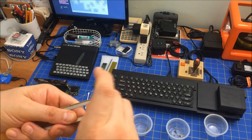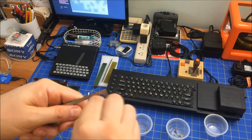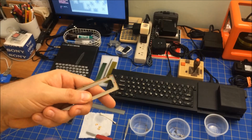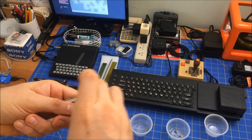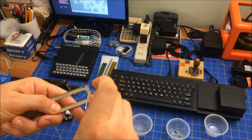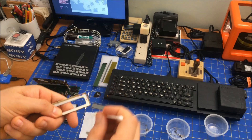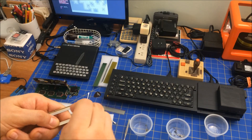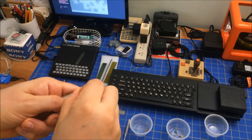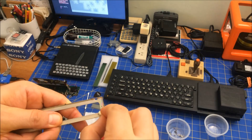Just going to rub it on here to try to get rid of the remnants of the glue - it's a painstaking process. This is a nice strong piece of metal, so it's going to be hard to bend, but you still want to be careful because if you bend it you can't mount the new LCD screen on there. I think that's almost free of all glue - there's still some, so it takes some rubbing and you have to hold it at a certain angle to get the glare to really see what's going on. I think I got it.